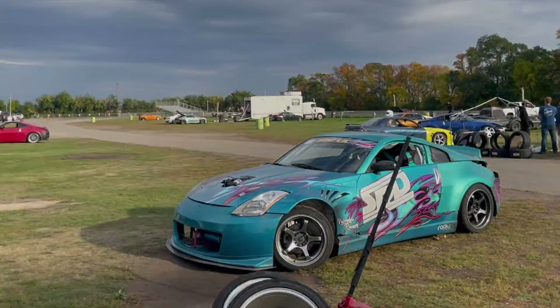We're working on this wrap, which has turned into a pain in the butt. We did a laundry list of things on this car, and one thing I forgot was the thermostat — no big deal, let's knock it out quick. Shining a little light on the subject, right down there you can see the thermostat housing. That's where things started to go south — the AC line is in the way, so you can't pull the housing off.